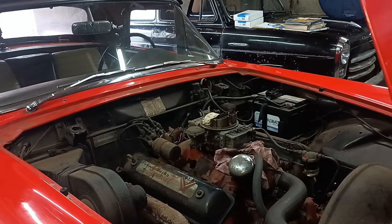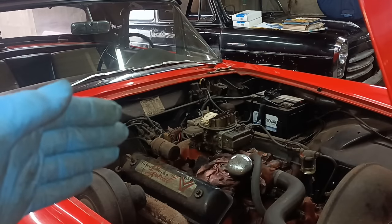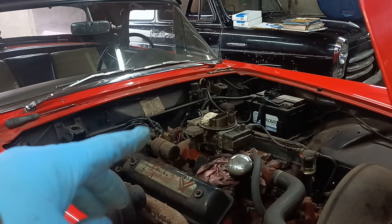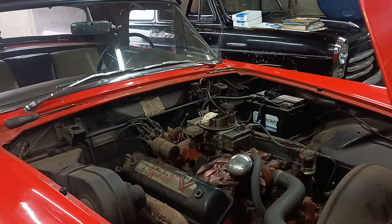Get back to phase one. Okay. I won't show all that. I'll bring you back when there's more to show. Okay, I've got the lighter metering body and the float chamber on. I'm just going to turn it over, see if the fuel comes out of that vent. It might do, because I've tried to set the float a little bit higher than it was. Oh, I don't know why I keep changing things. Let's just see what happens when I crank it.